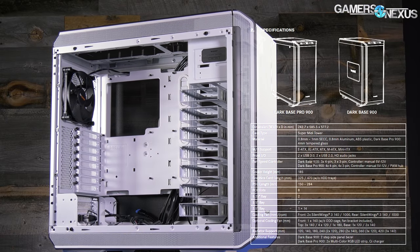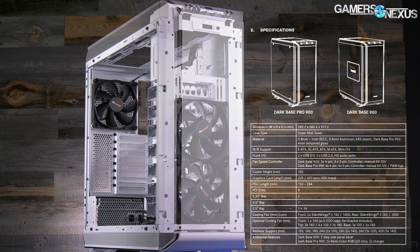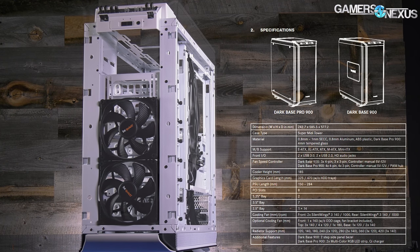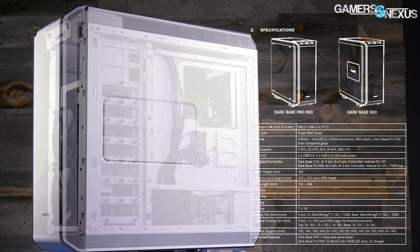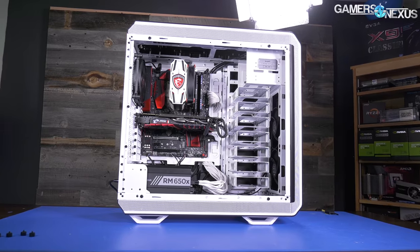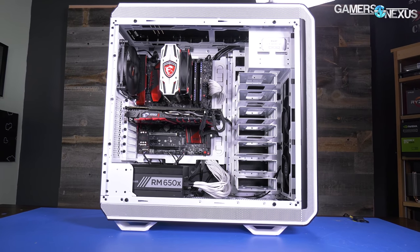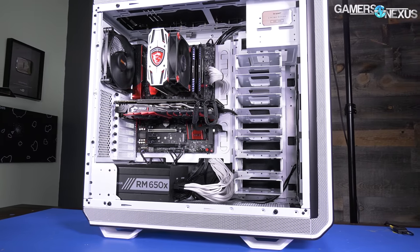The build was a strange mix of convenience and complexity. The Dark Base Pro 900 has a ton of features, notably the invertible layouts, that make it largely intimidating to build in — but you don't need to use all those features. Installing the power supply took several minutes of studying the manual: the PSU screws into a bracket, that bracket slots into four screws already in the case, then secured with two additional screws on the side, with an internal power cable that plugs into the PSU going out to the external one. The manual lists six slightly different ways to install the power supply. Despite the complexity, everything fits together exactly as intended. The top, front, and bottom compartments clearly had a lot of thought put into them — there are tons of places to install additional fans and radiators, all inside layers of acoustic foam and thick panels that Be Quiet takes pride in.